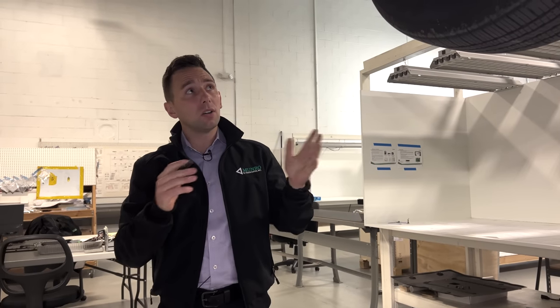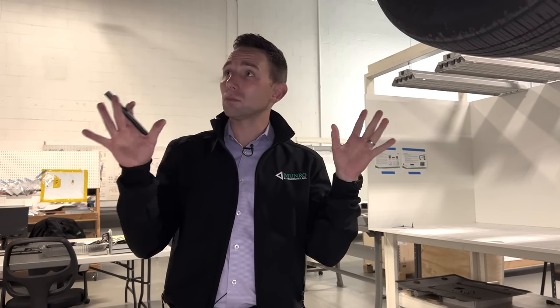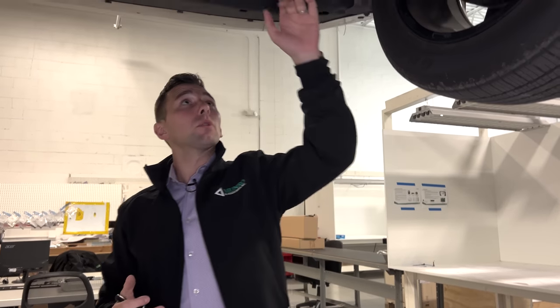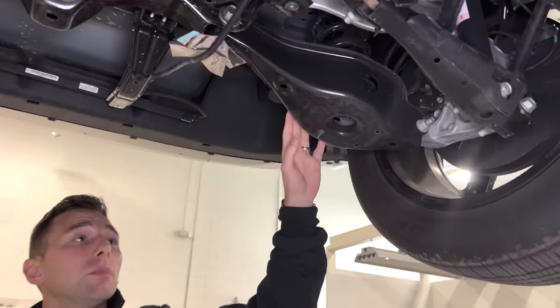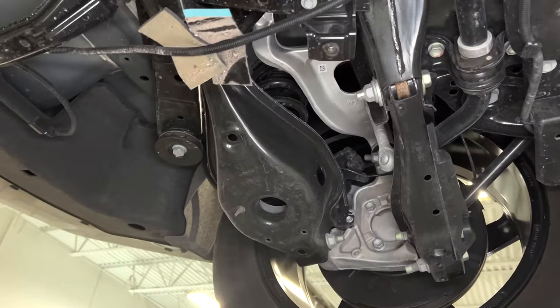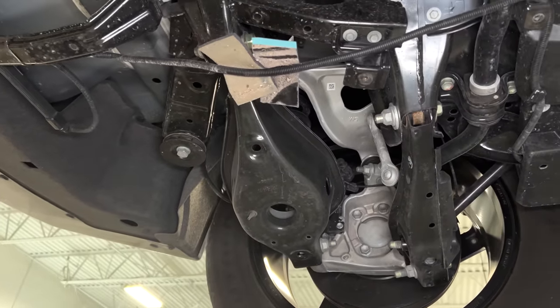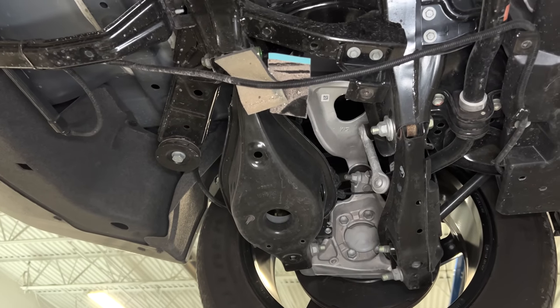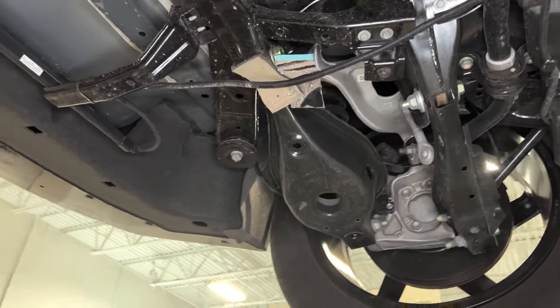All in all, the overall rear end of the vehicle is very conventional. Most of the links, except for one upper toe link, are stamped steel. This upper toe link is an aluminum member, the knuckles are aluminum, but other than that, very conventional. Julian, are you seeing anything unique in the backside of the battery pack or anything that's visible here?